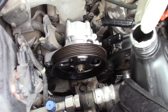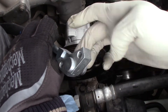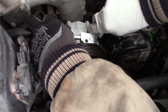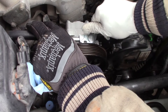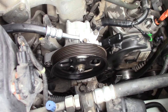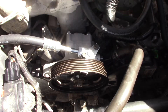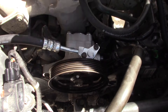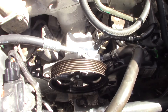We'll get a little bit of fluid to lubricate the O-ring right here. O-ring lubricated. Now this pressure hose can go on — twist it till it falls in place. Check out that shiny new power steering pressure hose and power steering pump. I had to loosen the bolts that hold this whole engine cradle in and lower the back end down about an inch to get at the bolts that hold in the pressure hose and wiggle it in and out. It was a pain.